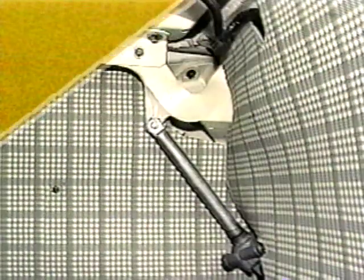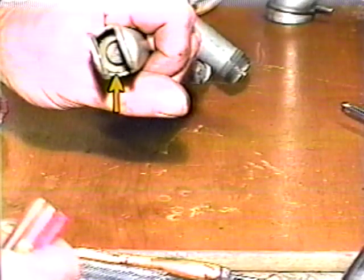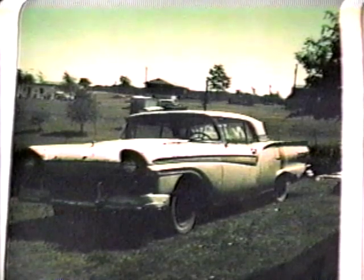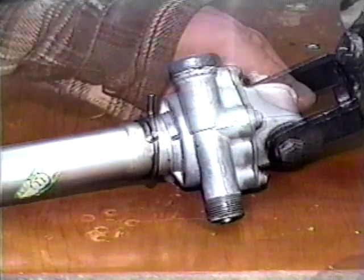The deck lift jacks are susceptible to water damage. They have seals at the top of the screw, but moisture still gets into them. When we bought our retractable, it had been sitting out in a field for 10 years or more, and the deck lift jacks were locked up tight. The nut parts of the jacks were rusted to the screws.